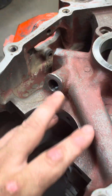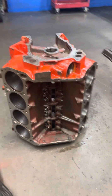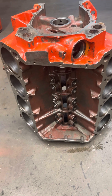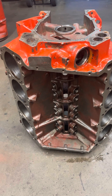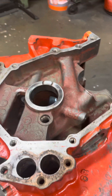The theory was you coated the whole inside of the engine block, lifter valley and all, and it would seal off the cast iron porosity and allow the oil to flow back into the sump and oil pan faster. I've only ever seen this actually stick and hold well on maybe two blocks ever. It's just too big of a gamble, and I would never recommend anybody do this to anything.